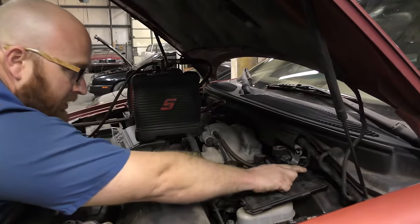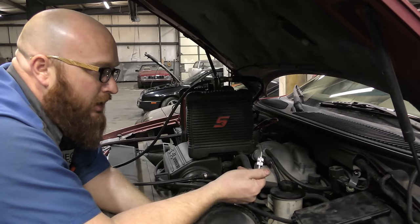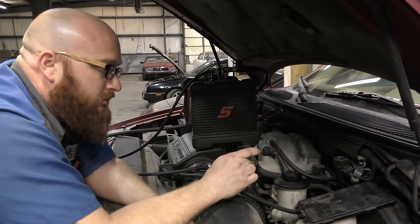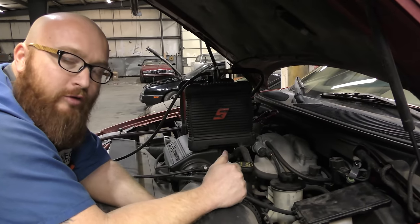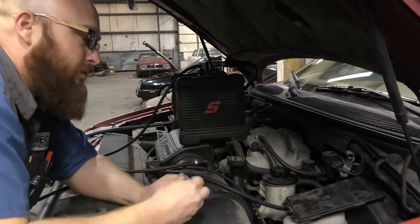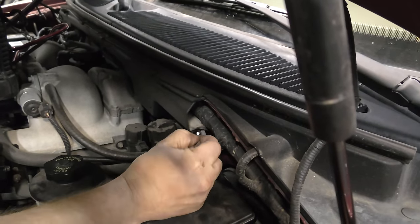Inside of this is a little Schrader valve, like on a bicycle inner tube. You have to use a little tool to get it out. There are special fittings that will just screw on and use what's there, but I typically take that valve out. Here's the key thing to remember, and I'm going to tell it to you three times because it will cause damage: unlike a typical bicycle inner tube or car Schrader valve for your tire, the threads on this valve are reverse — left-hand thread. Left-hand thread. Left-hand thread. I've stripped them out before when I was younger. You turn it the wrong way, the way you're not used to, to loosen it up.